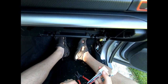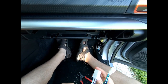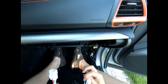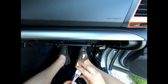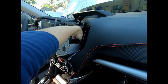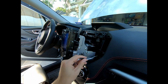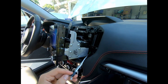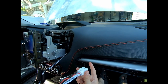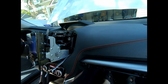I've got some harnesses that I purchased online — they were kind of expensive, but you can build your own. I'll put the link in the description, but it was from an auto harness website that sold a 10-pin and a six-pin connector that I needed. For this connector the top right matches the blue and red from the 10-pin connector, so I'm simply going to take my blue signal wire that I had to extend with a regular speaker wire and put it in here. Then I can plug that into the original factory harness and this end into the radio head — that way I am not cutting into any factory wires.